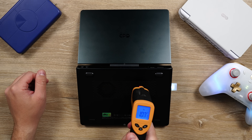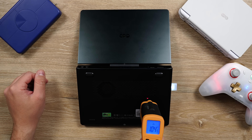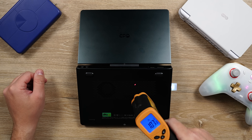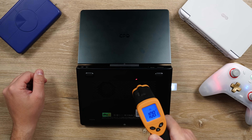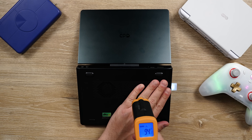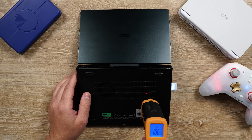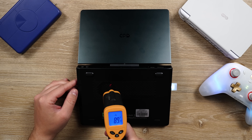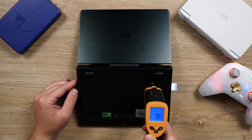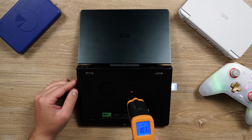Lastly, at the full 28 watt TDP, you're going to need about volume 50 or so to not hear the fan, and there are small hints of coil whine — but mostly just the noise of air being blown out. Unfortunately, the warmth is now heat on the left side and it becomes very uncomfortable to hold. I think there's rarely ever a need to crank this to a full 28 watt TDP unless you are going to dock it. But cooling and heat management at 15 watts and lower is actually really good.